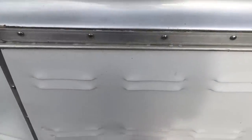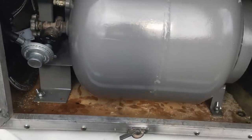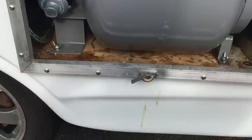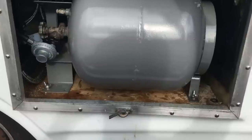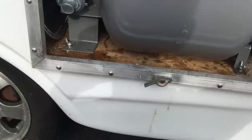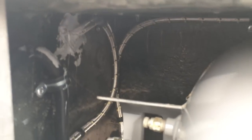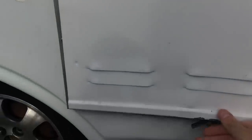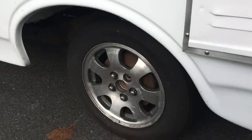This cover here has the propane tank in it. It's a horizontal propane tank, and it does require finding one that's been recertified because they're not purchasable new anymore — you have to find old ones. But the way it fit in this little cavity was perfect, so I decided to stick with it. There's a propane regulator, and it splits off to a few different devices inside: the fridge, the heater, and the stove all run on propane.